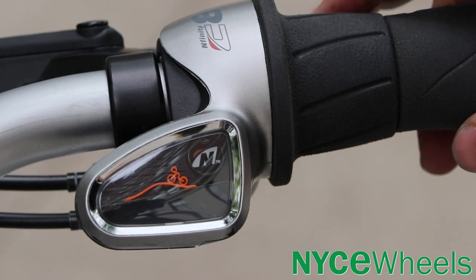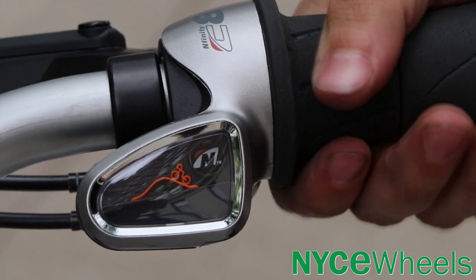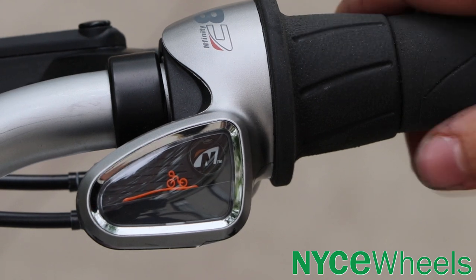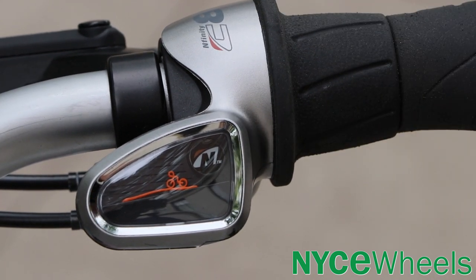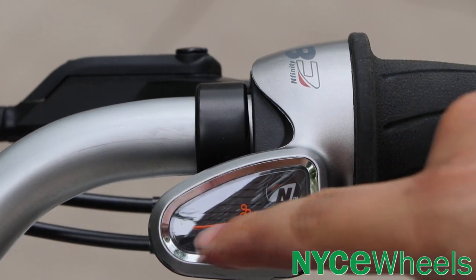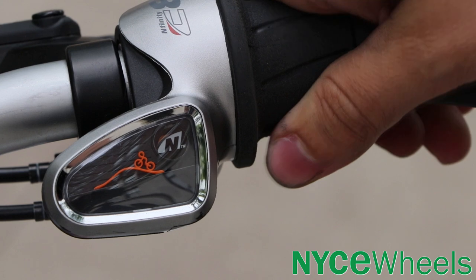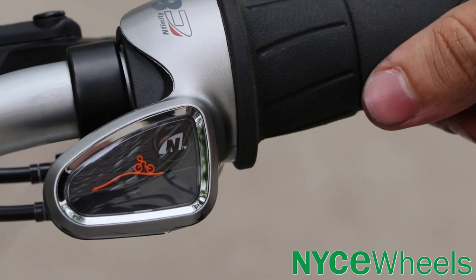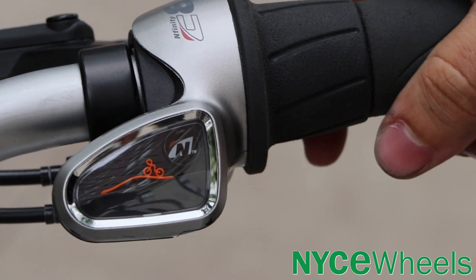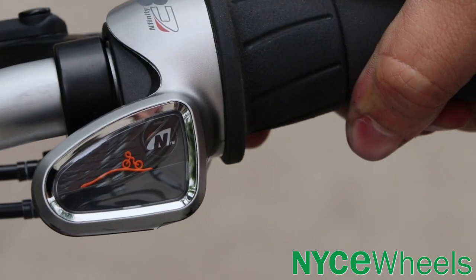Going into the drivetrain and shifting, this bike is equipped with the NuVinci Continuously Variable Internal Gear Hub. What's different about this hub is that there aren't individual gears that you click through — it's a smooth transition from a tougher to a lighter gear so you can always maintain proper cadence. As indicated by the rider graphic, flat terrain is the toughest gear and you can slide it up to ride up steep hills. It definitely comes in handy on a bike like this to have a very wide gear range, since you're generally moving a lot more weight and sometimes need to throw it into a really low gear.